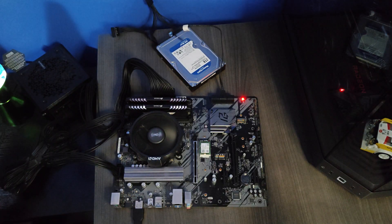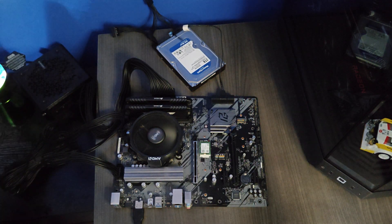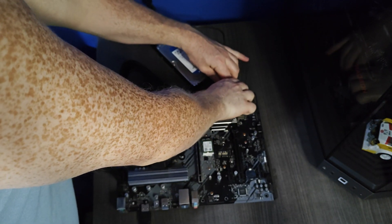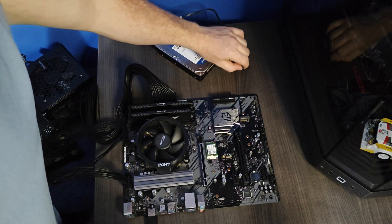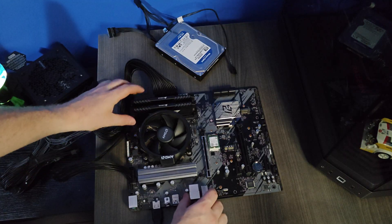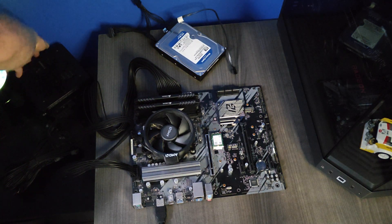It's not posting. I'm getting a light here that just says boot. I'll flip this off and unplug. Because if this is zapped and there's a problem with SATA, we'll unplug it and try to post again. And if it does post, well, then there's our answer. I'll probably still try every port.